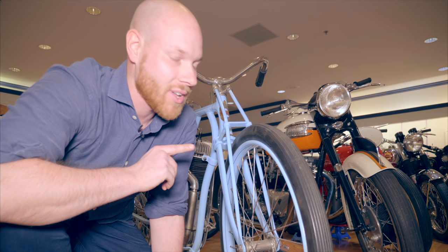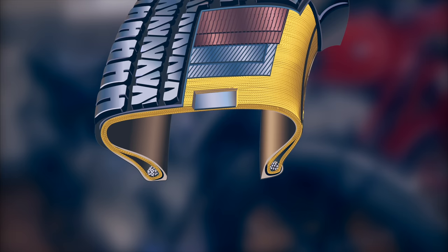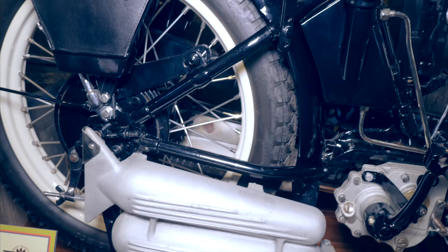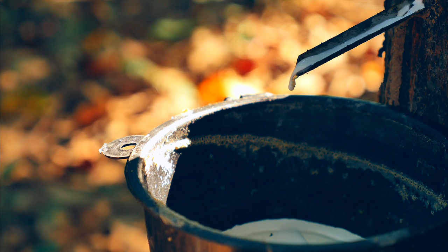Tires of the time were also very flexible due to the clincher interlock system used to attach the tire to the rim. This led Michelin engineers to try and find a solution, which they did using wired-on beads, which used steel loops embedded in the tire's edge to prevent it from expanding under pressure. The solution was implemented by all manufacturers in the coming years, and by 1930 all motorcycle tires and rims were designed in this way.